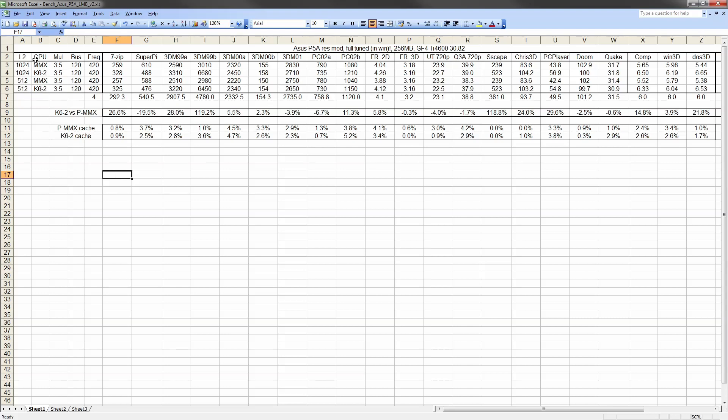I have four different configurations at exactly the same multiplier and bus settings. The motherboard was fully optimized and tuned as presented in my previous video, and for each configuration I ran my classic 14-test benchmark suite. One important thing: regarding optimizations, there is a difference between the MMX chip and the K6-2. Fast write combining and general DOS optimizations are only possible with the K6-2 chip — the Pentium MMX does not support this, as Intel added this functionality only to later chips.